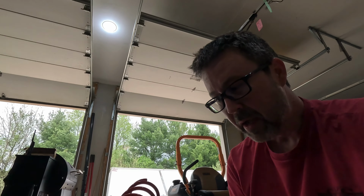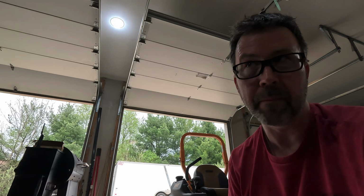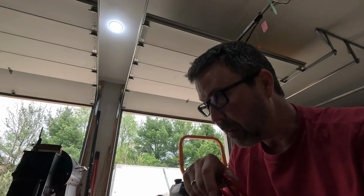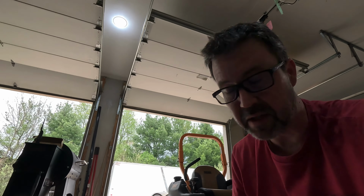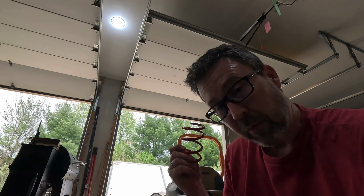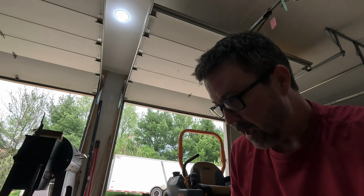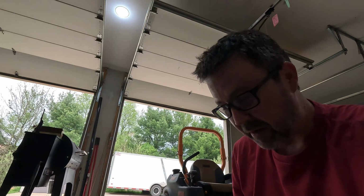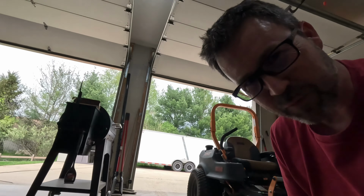The best option that Evo has is this red spring. It's a 2300 stall, so you could run a 2200 RPM two-step. I believe it's 7-ish pounds, but we'll go over that when we start to test this thing out. So that keeps your trail ability very good and still allows you to have some fun, guys. So this is going swimmingly so far. Let's get this red spring in.